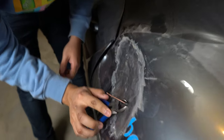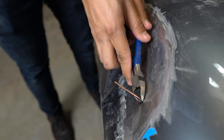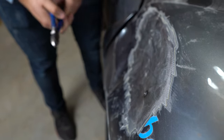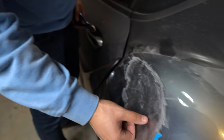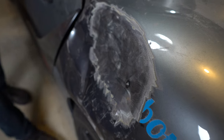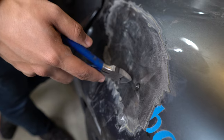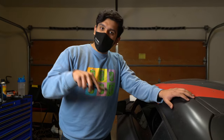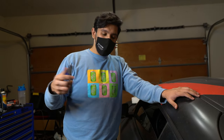The way to pull these off is to use a pair of side cutters — some in the industry call them dykes, which I feel like really isn't a very 2020-friendly term. Just like that, and then basically you just grind that off and you're good. If you pull it out and there's a hole, you just spot weld, grind it down, smooth it out. If it pulls out a hole into the actual panel, you use a MIG welder, MIG it, and grind it down. Or actually, somebody in the comments of the YouTube video we watched said just weld another stud in there and then just cut that one off and grind it down. People on the internet know what they're talking about, man. Believe me, I'm a guy on the internet.